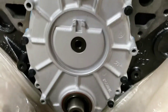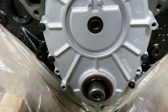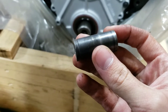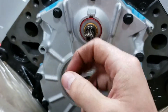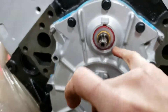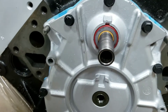How's it going everybody? Today I'm going to make a real quick video showing on these LT1s. They have a water pump coupler here and there is a right and a wrong way to slip that over the water pump drive shaft. A lot of people online whenever they're changing this seal out just go through and put it on any old way.